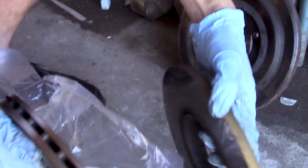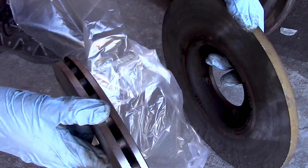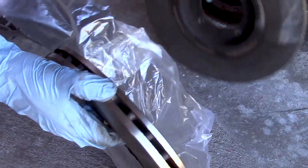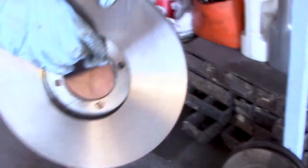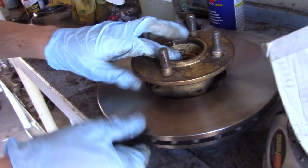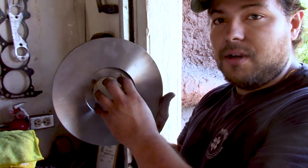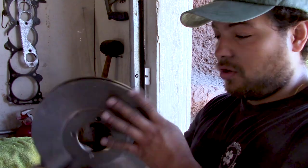This is solid. And you can see this is almost like two pieces and there's more cooling, so hopefully we get a little bit of braking. We want to do a test fit to make sure that they line up the right way. Make sure the recessed part of the new disc brake is towards the car so you don't put them on backwards.